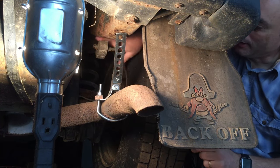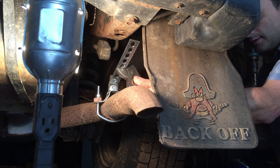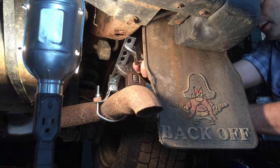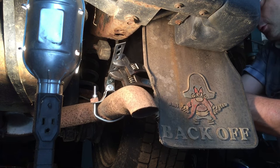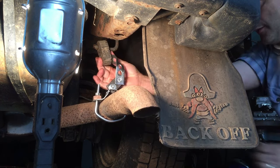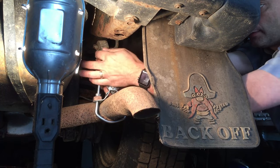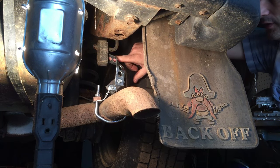I'm just gonna use that hole to put our new bolt through and bolt to this. You just want to clamp on one side of it like this, then clamp your wrench on the other side, and twist the wrenches opposite of each other — that gives you the twist you need to put the bolt where you need it. You can see now it'll be supported by this, and this is just gonna go up, curve, and then this hole lines up with the rubber grommet. We'll go ahead and put a bolt right through there.